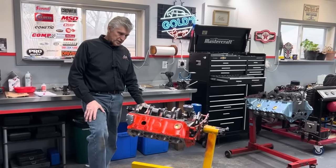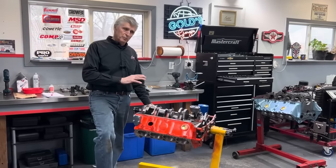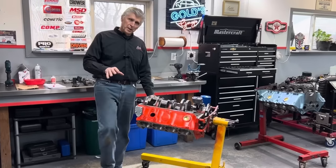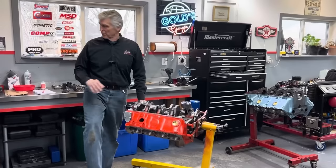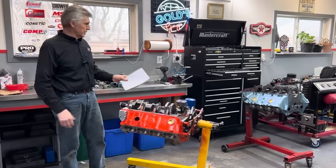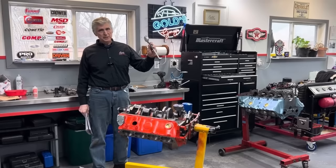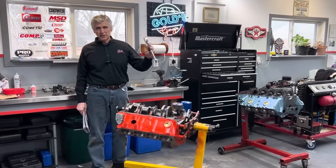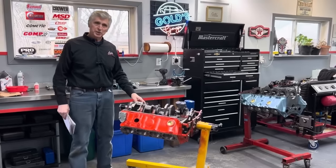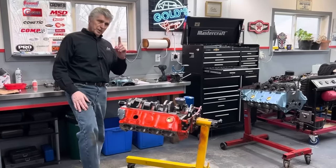What I decided to build is a 406 — it's going to be a 406, about 400 cubic inches. I've already had all the machine shop work done. We decked the block, that worked out good. I've already mocked it up. My son's coming down in a couple of weeks and we're going to do the final assembly, but I'm mocking everything up and taking all the measurements — crankshaft clearances, piston-to-cylinder-wall clearances, rod bearing clearances — all with a dial bore gauge and a micrometer. You need to check, check, check everything. You cannot take a chance, especially on a race car motor that's going to see lots of RPM, lap after lap.